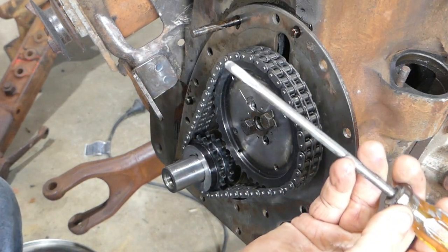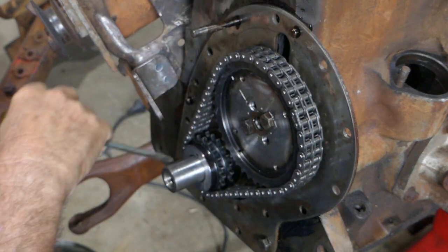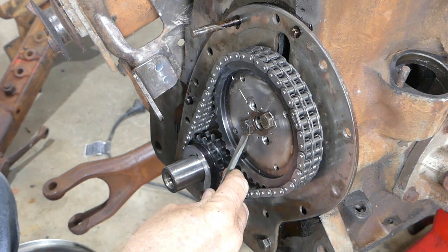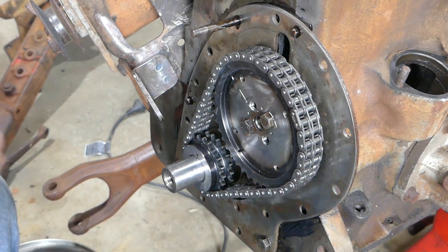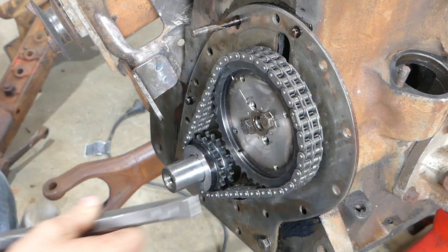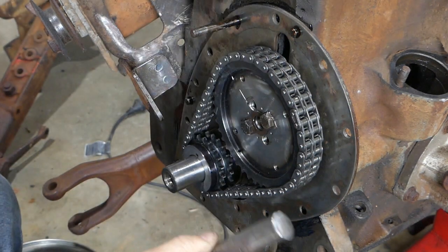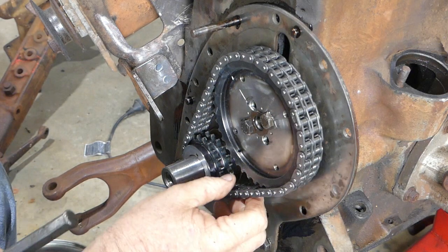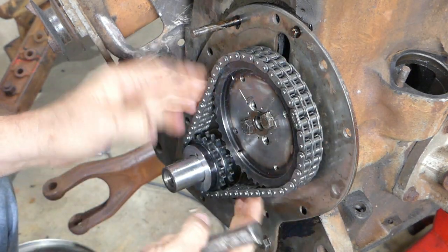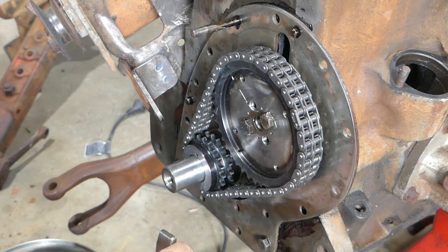That's supposed to be about 20 foot-pounds — go to your elbow clicks. I've got a rounded-off screwdriver — flat one side, rounded the other — so we don't mark things up. We'll come in on this fella too, and we'll knock the spanner off the back of the tractor. New chain, new sprockets — I'm really happy with that; that has to be timed well.